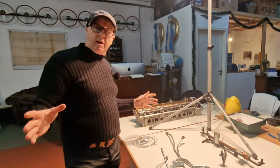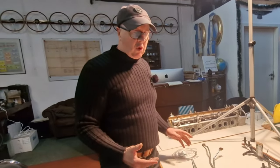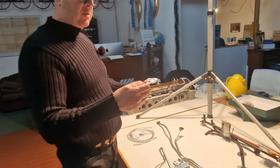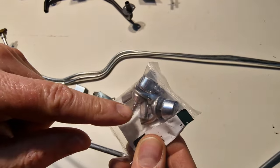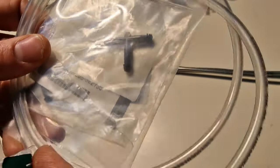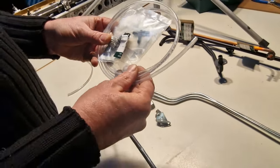Now we're going to have a look at the parts I've been working on in between — it is a reminder of what you have to do in the meantime to not delay your reassembly when everything comes back together. My belief is that one of the first and most important things you need to have ready when the shell comes in are the windscreen washer jets — the screen nozzles. Because otherwise you cannot reach those without great difficulty. This is one of the most important items to fit, along with the connector for the two hoses going to the nozzles.